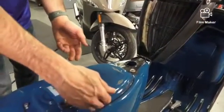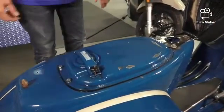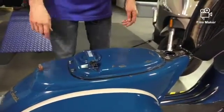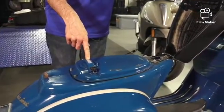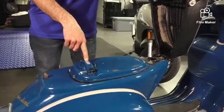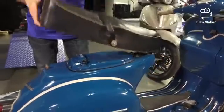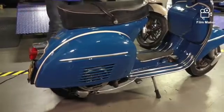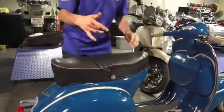They had a tank that's kind of bumped up. It gives us a small boost in capacity, and also moves the tank a little higher so the fuel delivery is a little bit better for the gravity fuel delivery. You mix these at a pre-mixed 5%, because unlike the later Vespas and just standard run-of-the-mill Vespas from 1959 and later, like 150s, VBBs, VNAs, or even any of the small frames, which were a rotary valve design, these were a piston port design. That's how they handle the induction of the carbureted air and fuel mixture into the engine.